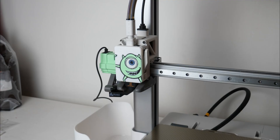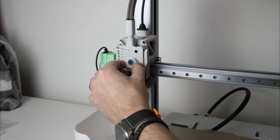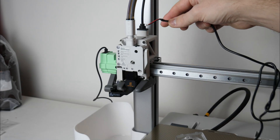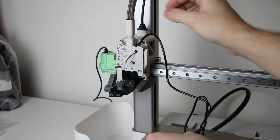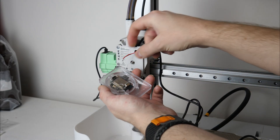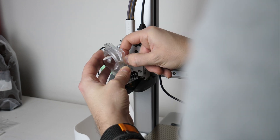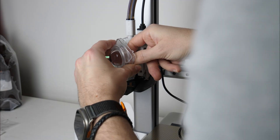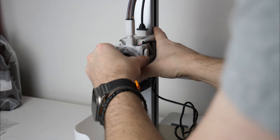Now I can take it over to the machine and show you the installation procedure. If you've never taken the front cover off before, just squeeze at the bottom, give it a little pinch, and lift up towards you — the whole thing will just lift off. That yellow wheel attached to the filament cog will just pull off too. The cable feeds through that small hole there — don't try to feed it anywhere else. I thought this bit was going to be more finicky and tricky than it actually was; it was surprisingly easy. Then the cable just needs to connect into the back of the display — there's only one place it can go and only one way round. Don't try to force it; just take a step back if you're having a problem. Then the top hooks on and the bottom just pushes until it clicks.